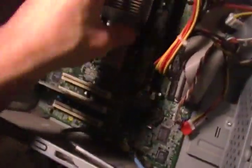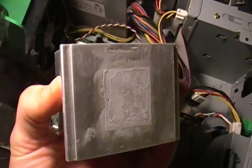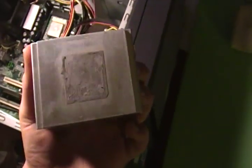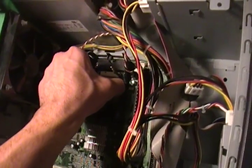First we remove that, then remove the heat sink, which is very easily done. It has some very old — about six or seven year old — thermal paste on the bottom, which is horrible. This stuff should be changed every year or every couple of years; this is the same stuff that was there from the manufacturer — I can tell because it's in a perfect square around the edges and it's very dry. I'm carefully taking the CPU out and setting it down on a soft foam pad so that the pins don't get bent.